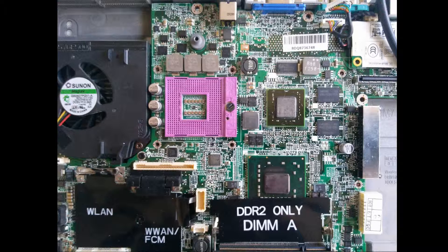The CPU was cold, which means that it wasn't working. What could cause that? The standby power was reaching the power button, since it was trying to start the computer when you pressed the power button.